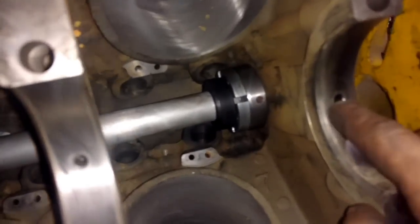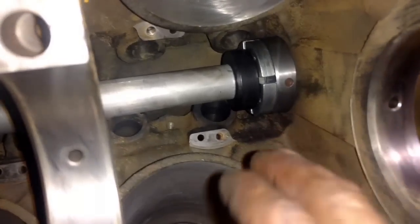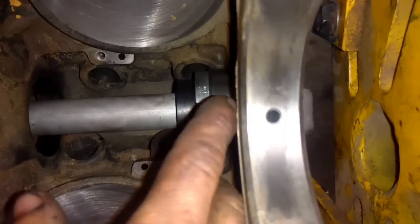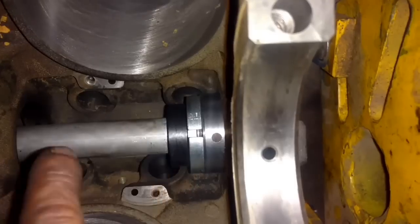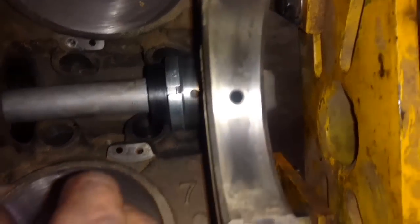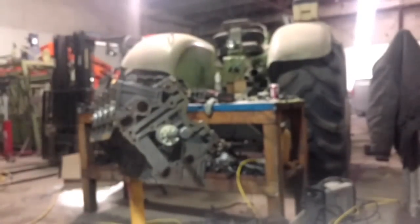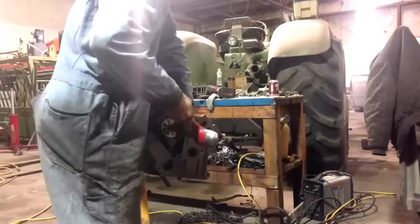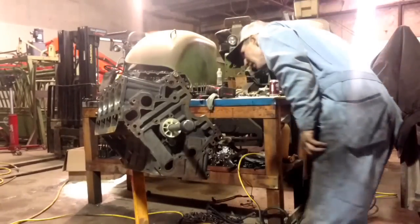When you're putting these in — this gallery here feeds your main bearings and also feeds the cam bearings right on the other side. You can line up your cam bearing holes with these. Once you put it in, you might have to take your cam bearing installer out two or three times to make sure your depth is right and that you're lined up. You can also look down the hole with a flashlight to see if you're lined up. It is critical to have those holes lined up. The cam bearing hole itself is a little bigger than the oil gallery hole, so there's a little bit of forgiveness there.